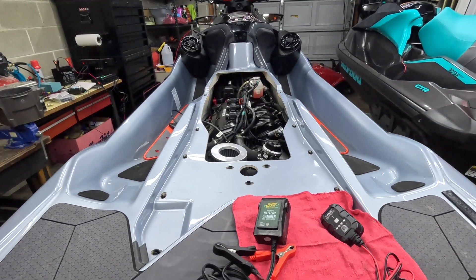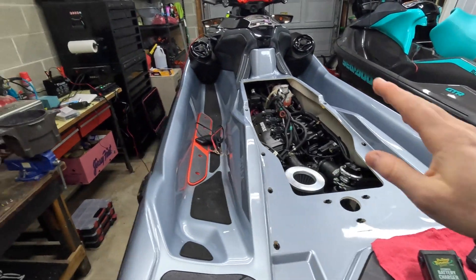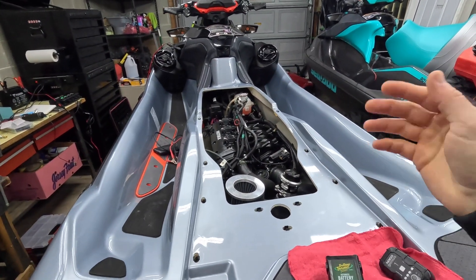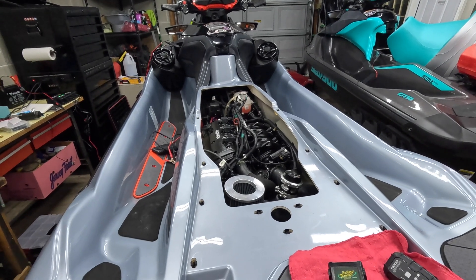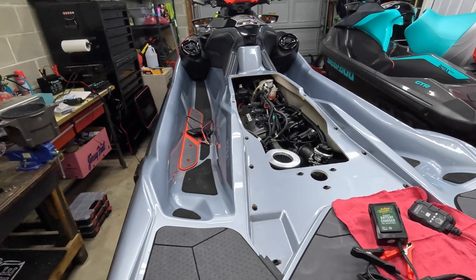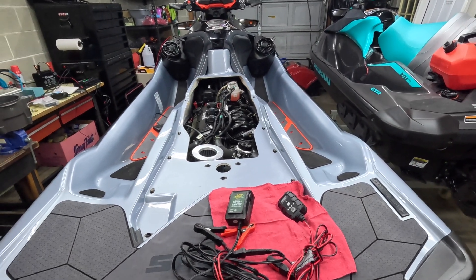So there are pros and cons. For some people, lithium iron phosphate batteries work perfectly fine. I personally am still sticking to AGM batteries because I like having the ability to jump the battery if I need to, and I like having that voltage protection system built into the ski. If the battery warning comes up or my speakers stop playing while I'm out on the water, that means my battery's almost dead and I should start the engine. That's pretty much it for this video — how to maintain, how to test, and the different issues from a bad or end-of-life battery. Leave any questions below and I'll be happy to answer them.